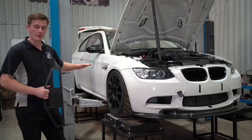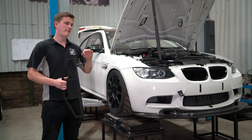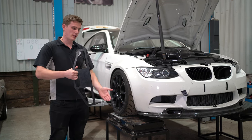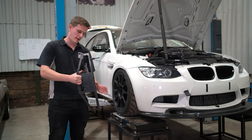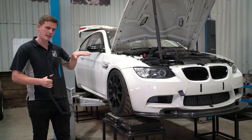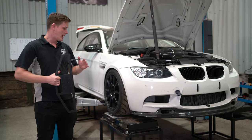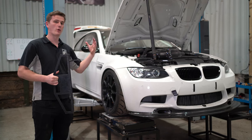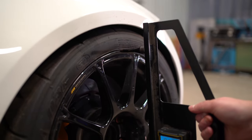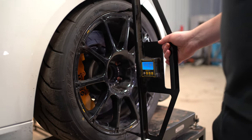For camber it's important that you have an exactly flat patch, because if you don't, the lay of the land will come into the reading. If you can't get a flat patch, a digital camber gauge is a great bit of kit because it can be calibrated to the floor — you can lay a spirit level down, sit the gauge on top, and zero it to the angle of the ground. We're going to be using the BG Racing digital camber gauge today to take measurements around the car and get the camber set before we build the string and line kit for toe. When measuring camber, you want the gauge set exactly at the top and bottom of the rim, held as upright as physically possible, then adjust the camber to get the number you're looking for.